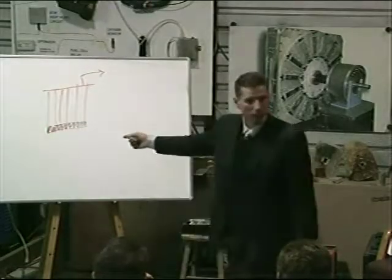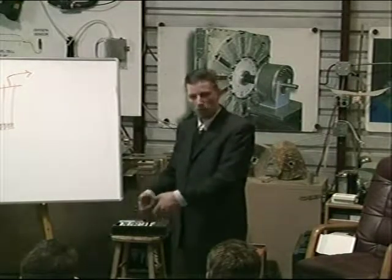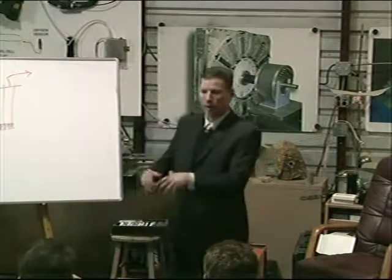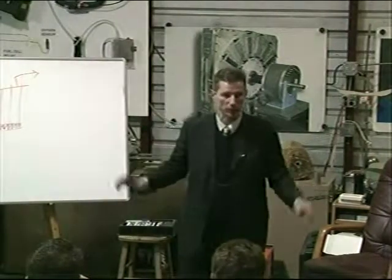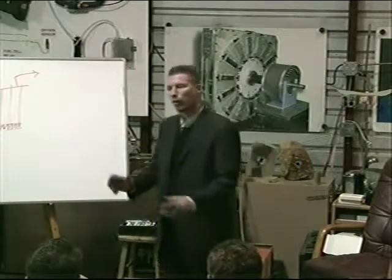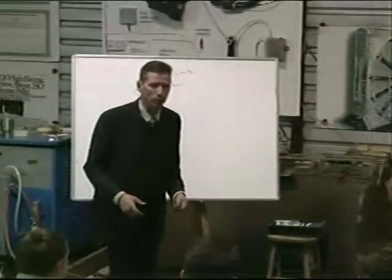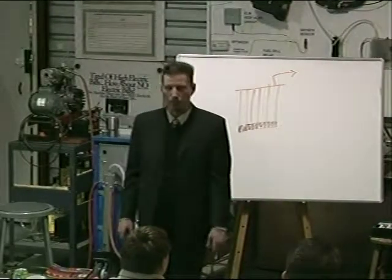So anyhow, you remove the unit and you dispose of what's in there properly and rinse it with water, empty it. Rinse it with water, empty it. By the way, potassium hydroxide is drain cleaner, so going down the drain is perfectly safe. And anything else in there was probably from the tap water, so again, down the drain is perfectly safe. Rinse it with water quite a few times, shaking it up and trying to break it loose. You'll get a lot loose, but you'll look down in there and you'll see there's still a residue.